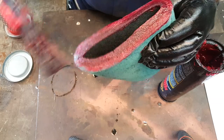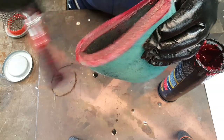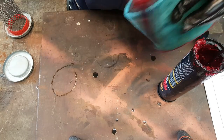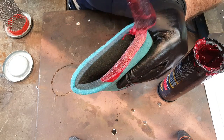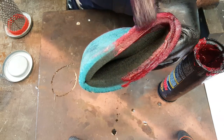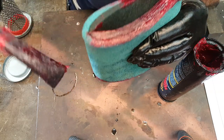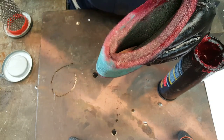It's going to wear the bore, cause the thing to burn oil, lose power, lose the race, number two, not number one, all that kind of stuff. So make sure you get the grease put on. That's what it's all about, doing a proper job, not half a job. There we go. Both ends. Like I say, you don't need to blather it in grease. It just needs to have that extra bit, and that's your protection. It's all about servicing your bike properly.